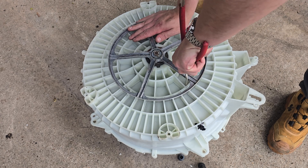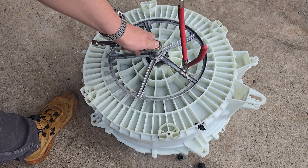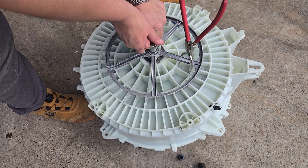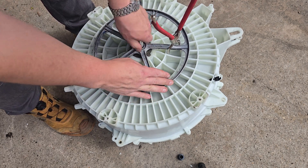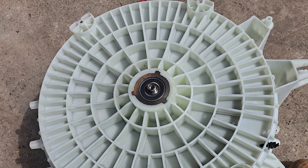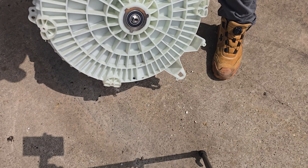This is the drum pulley. We use a tool to hold it in place — for once we don't need a 10 millimeter socket, rather a 17. Hold the pulley in place and crack that bolt on the back, allowing it to be removed. When we've got the drum pulley removed, we can see our bearings. These are the most common point of failure for most cheap washing machines.